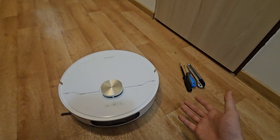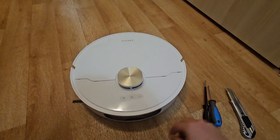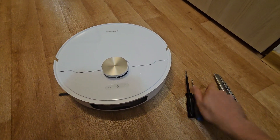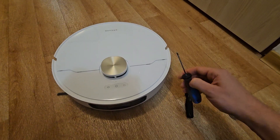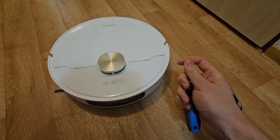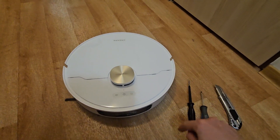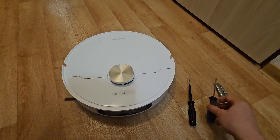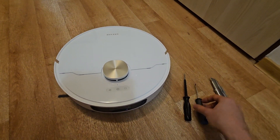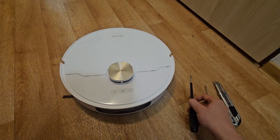What you'll need is a knife, since there are a bunch of rubber seats that need to be taken out, and then a small Phillips screwdriver. I recommend using a dedicated screwdriver rather than one with detachable bits, because some of the shafts where the screws are are really narrow. I also have an iFixit kit but I cannot push the iFixit screwdriver through those holes, so you need one small and one bigger Phillips screwdriver.